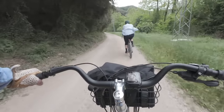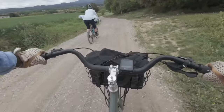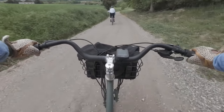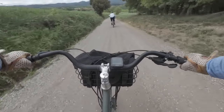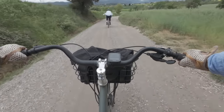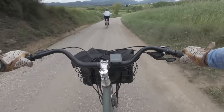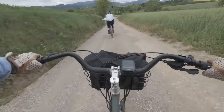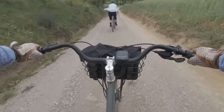With the original tires I always felt it was a little bit underbiked on gravel — not enough suspension, not enough grip. But with the Speedmax tires it felt right at home. I was running them with tubes, so I couldn't get too wild with the tire pressures — keeping it in the upper 20s. If I were to run this tubeless, I'd probably dip into the mid 20s, if not the lower 20s for tire pressure, just to squeeze out the maximum suppleness.